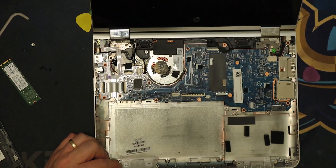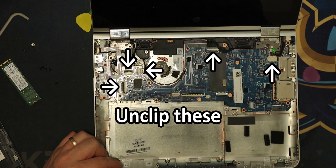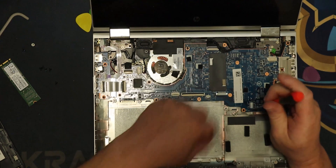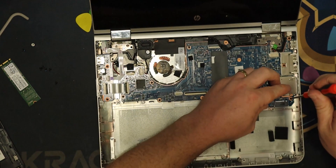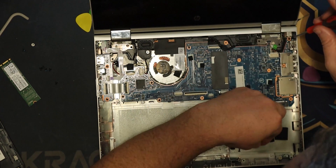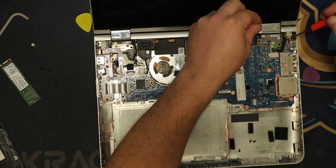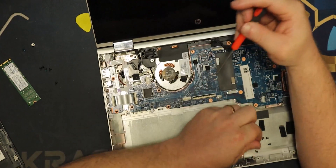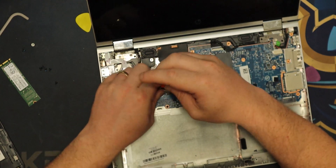We're going to go a little bit further here because we want to get to the underside of the motherboard. There's a whole heap of screws highlighted — go ahead and remove all those, along with the ribbons and clips; we want to unplug all of those. There is also one other plug which is pretty obvious once you lift up the motherboard — it's over on the far left-hand side. It's the little hold-up battery, which keeps the time, date, and settings stored in your laptop when it goes flat and is unplugged for a long time.